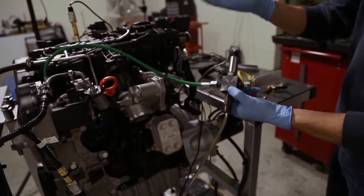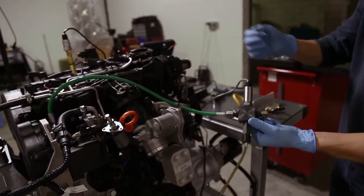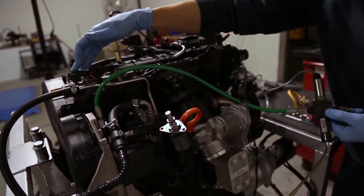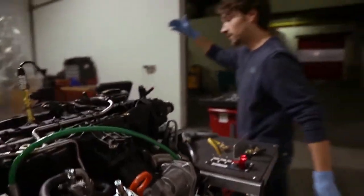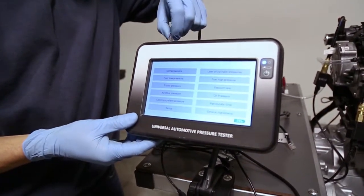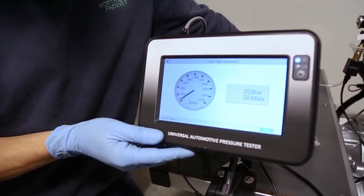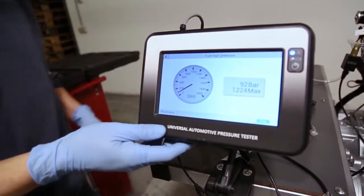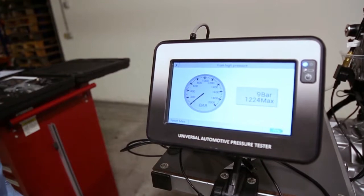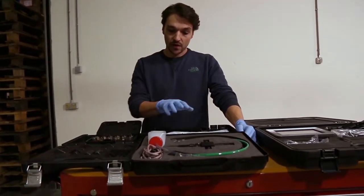If we want to make the engine run, we need to connect the second hose from here to the common rail — otherwise the engine won't run because it's not being fed fuel. Let's go back to the screen. I'm connecting the sensor. We have what I would say is a normal pressure. If the second hose were connected, you would have a running pressure of around 300 bars. To clarify, these three sets are for diesel common rail only; gasoline common rail adapters will come very soon.